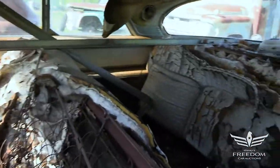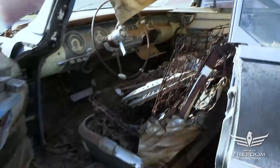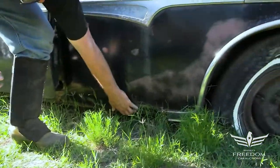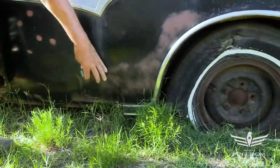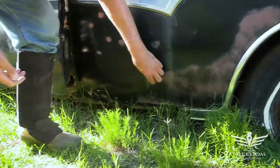Maybe another hubcap somewhere in the car. The seats are intact-ish — the springs and frame are there, and that's really the bones of what you need. The rest of it can easily be rebuilt. The quarter panel down low is a little bit bubbly, which is kind of to be expected, but the rust stops there, and on the way up it's very, very solid. The lower rockers do need some patchwork done.